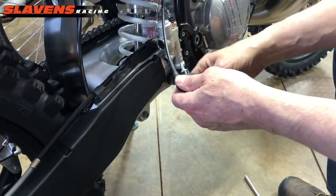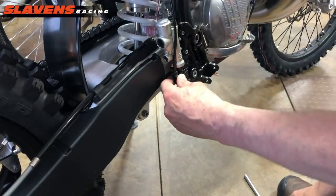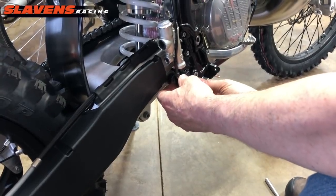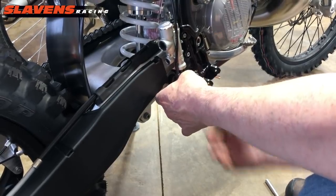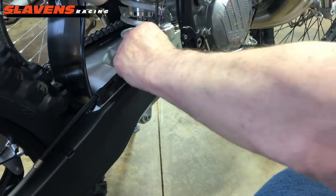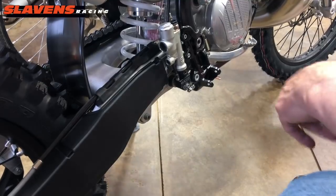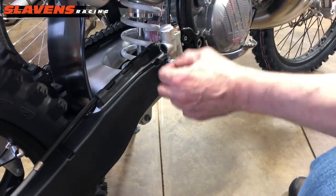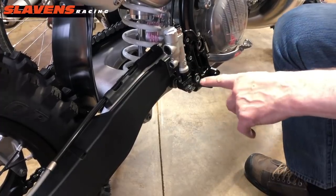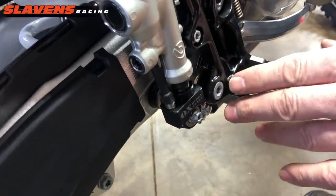Now to get this back in there, get the bolt to line up — you need to push this back in. So I'll push it back down. I'll just get the bolt started in there. So now it's in, it's ready to go. It's really just that simple. I've got my right hand up here on the lever and I'm squeezing it. If you come in a little closer here with the camera, you can see this plunger moving back and forth. And that's all there is to it.